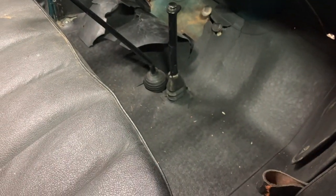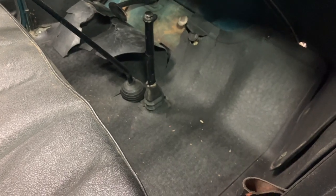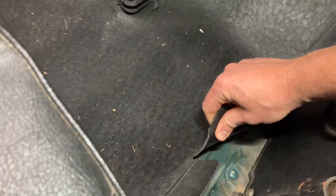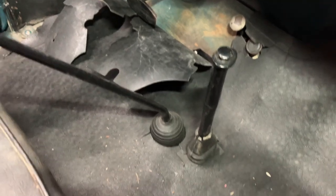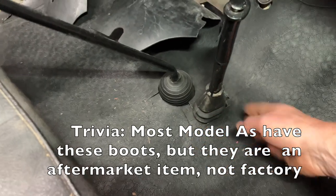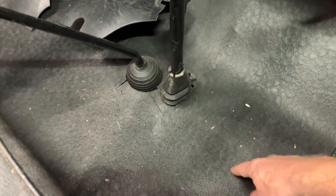The next thing is to come up into the front cabin and take the rug off, or the rubber mat — whatever your car is equipped with. Rugs can have up to seven snap fasteners that you have to loosen, so look around for those. Once you've taken the floor covering off, take off this metal plate here. There's also supposed to be a plate here around the steering column and the pedals — if you have one, you've got to take a cupped washer and a screw out there and one on the other side.